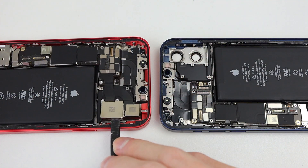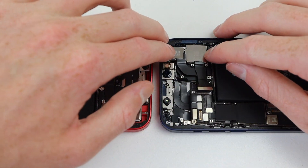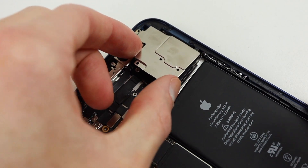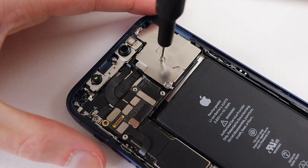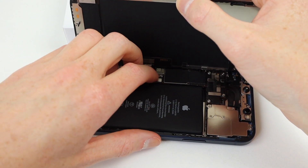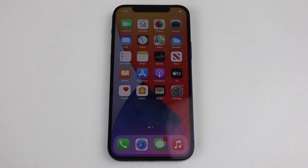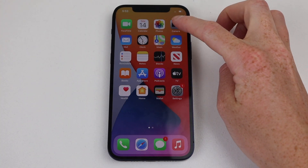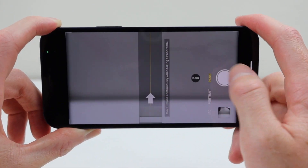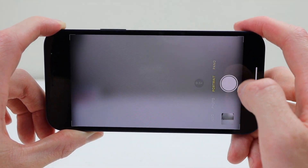Removing the cameras from both iPhone 12s, I'll swap them to the opposite phone, making them not original to the phone but still a genuine Apple part. I'll reassemble the phone just enough so we can test it out and see if we get any issues or warnings in iOS 14.4. After reconnecting the front display and battery, I could test the phone. Booting up, I saw no immediate signs of any notifications or warnings, and in the camera app everything works as expected — all modes and functions including panorama and portrait mode are working.